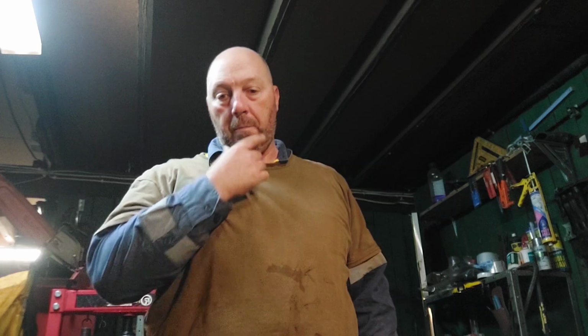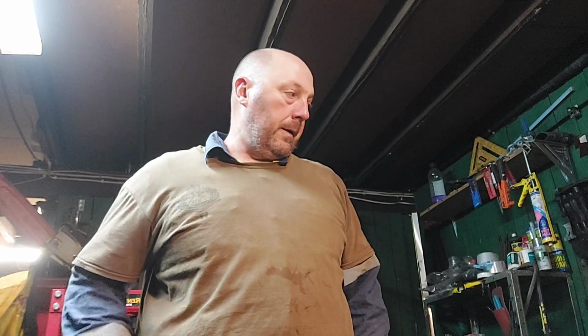Not much time to get stuff done, but I worked on the Dodge WC-51 seat pans. I basically got stuck into the bottoms of the pans where they had the blue paint with the needle scaler. Knocked all the blue paint off and just levered out the little latches on the side that go for the wire seat frame. And chased the threads on one of the pans for the captured bolts.